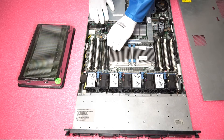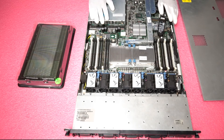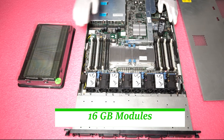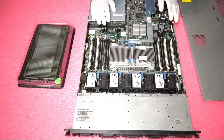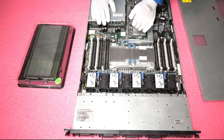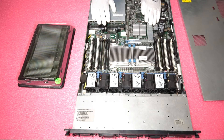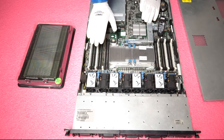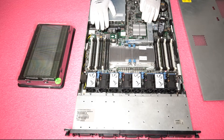This is very inefficient and low-performing right now. Our goal is to load it up — we are going to put in 16GB modules, building a 288GB configuration for our customer. With only two 1GB sticks, performance would be absolutely terrible. Memory is the best way to increase performance. CPUs are far ahead of the other parts, so upgrading them will help, but it's the memory modules that will boost performance the most.